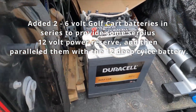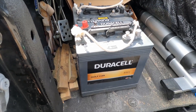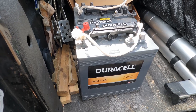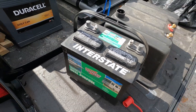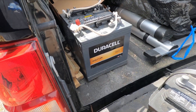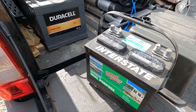That was part one. Part two is I added these two six-volt golf cart batteries, which gave me a lot more power to work with and honestly ended up being the batteries that were actually connected, because I don't believe this original battery was really doing much. At least I could see these batteries and check their water levels, but the original one was very difficult to get to.